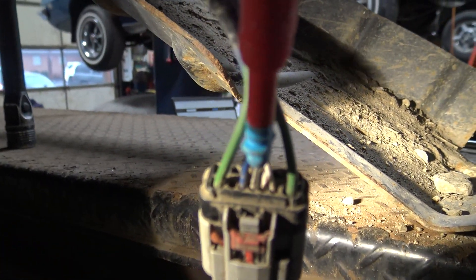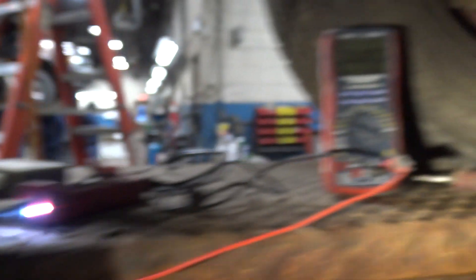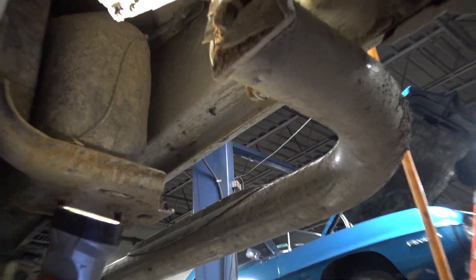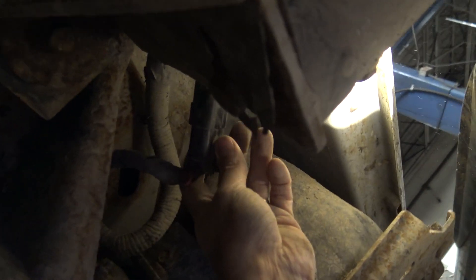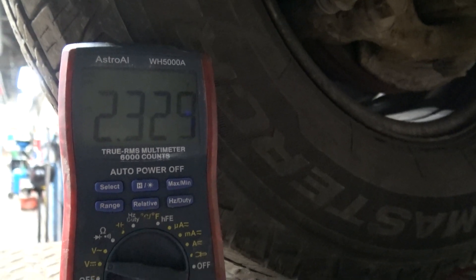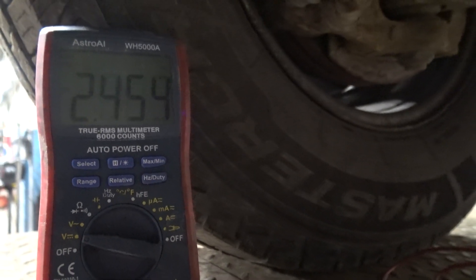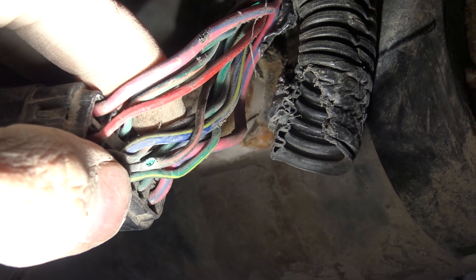We're back-probing our dosing control unit circuit. This is unplugged, but we still have a bad reading — it should be battery voltage, and we're at 2.49 volts. I'm on a drive-on rack so it's kind of hard to get manipulated around where I want to go. But this is the connector in the diagram right here. I'm wiggling this around, and as I wiggle this, you can see our voltage definitely changes. If I push a certain way, I've had it down to zero volts at one point. So the big question is, where is this problem?